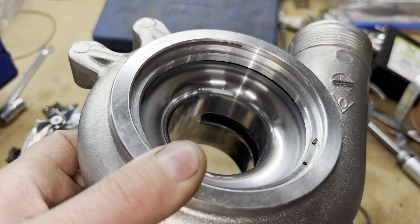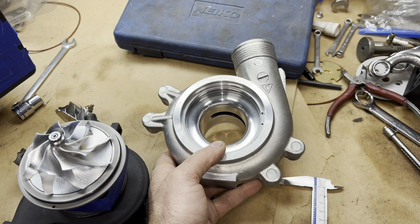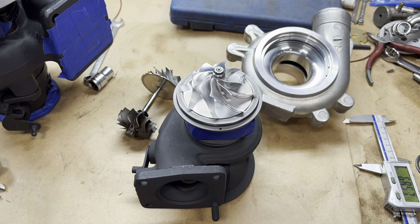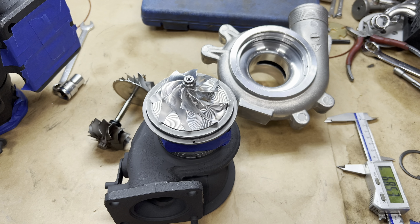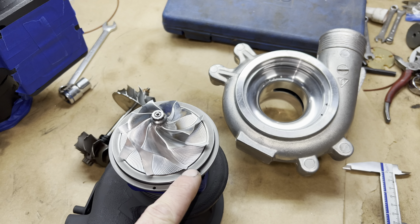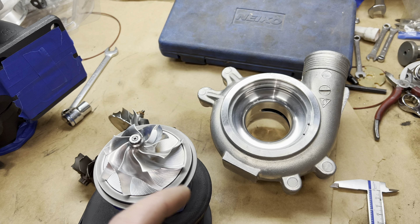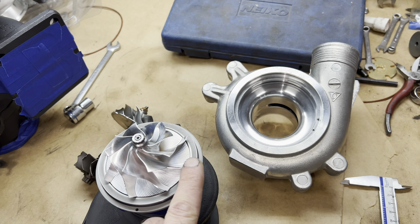This is what it looks like machined. I'd like to write a CNC program for this — if anyone has the ability to do that or has the wheel dimensions, I can have that done and could offer this to other people. Otherwise it's a hard build without the CNC program. With the CNC program I should be able to get this done in about 20 minutes, but because I didn't have the program I had to measure to the tip of the wheel, cut it flat, and then use the other wheel to paint and mark where it was touching, cutting until the wheel had proper clearance.